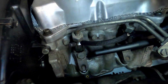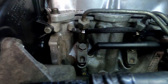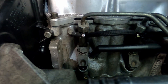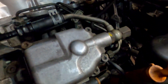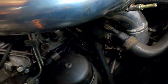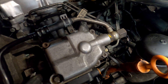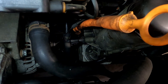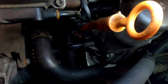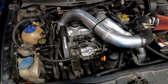I currently have 300-micrometer injectors from Jared March with slight mods. I consider them a hot street injector — they're very easy to make clean and they make very good power. The engine itself is actually an ARL PD-150 block, ARL crank, and modified ARL pistons — they're de-lipped with deeper valve reliefs. There is an oil cooler that came with the ARL; I'm not sure if all of them have it, but it is the larger oil cooler, same as a BHW would have.